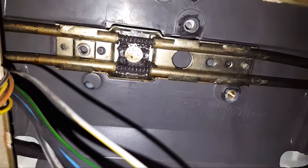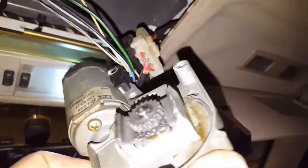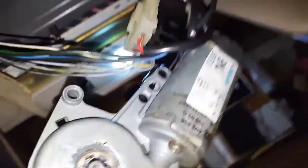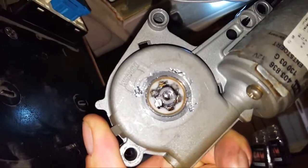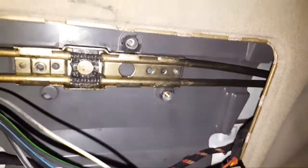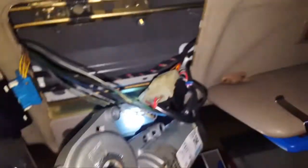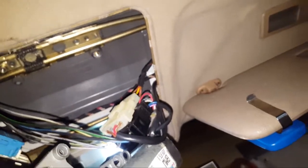There's the motor pulled out. You're gonna notice that one of the screws is longer — just keep in mind where that goes. Now that it's pulled out, you can see the cables underneath, nice and dirty. The sunroof's manual function is still binding just the way I fudged it up. The little allen key fits in there and manually turns the gear, but my alignment is between the first and second cable. I'm going to set all my screws down and try to wiggle the sunroof into place, and I'll show you the reset for the motor.